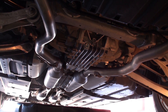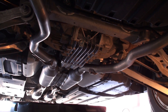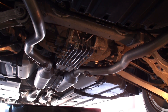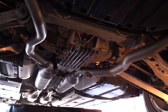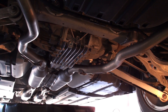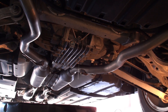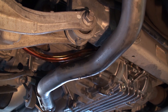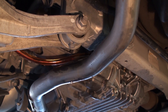You don't necessarily have to fill this thing right to the max. The guideline for the hypoid gear chamber is 0.7 to 0.8 liters, and I actually managed to fit almost an entire liter before it started dripping. I don't really think you can overfill using this method, and also be aware that if you're slightly underfilled it's not going to hurt anything — being short 50 to 100 mils is not going to make the slightest difference in performance. The hypoid gear assembly is filled, so now let's fill the clutch assembly, which takes approximately 2.7 to 2.8 liters and is filled via the side fill hole on the back of the rear differential.